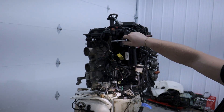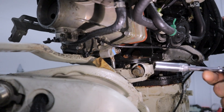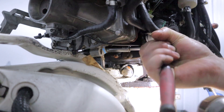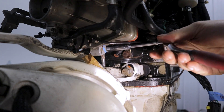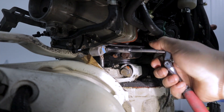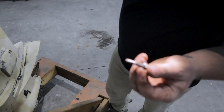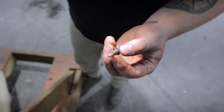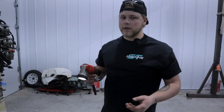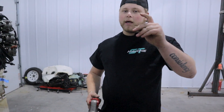On the port side at the front, we're going to work on the shift linkage. You can use a flathead or a 3/8 socket. It's a shoulder bolt — there are threads at the beginning and the end is just a pin. Remove this entirely and the power head will be separated from the shift linkage. Note: if you were doing a water pump and dropping the lower unit, this is what has to come out for the lower unit to drop. Do not lose this bolt.